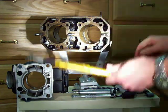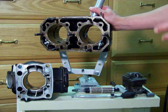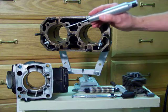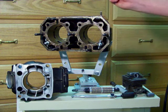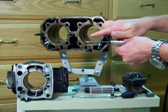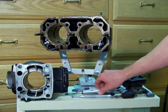What you'll see a lot of people try to do is use a straight handpiece to do that — they'll reach through here, or reach across from one side, or try to reach in. You cannot get the proper trajectory or the proper angle with a straight handpiece. These are great for doing the outside work, edge work, and about a million things, but they're not for doing transfers or chamfering the interior of the combustion chamber. As you press against this, the carbide shank will tend to bend, get off center, and helicopter — spinning out of control — which can damage your cylinder head, your tool, and you.